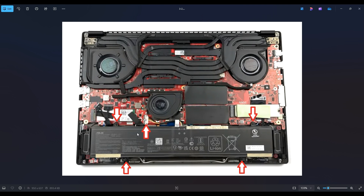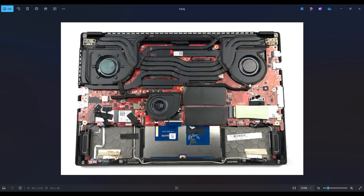I will have a video link below in the description — a tutorial showing you how to troubleshoot a laptop that's not turning on. You have two M.2 PCIe X4 slots here. The one on the right is where many of you will have a solid state drive in stock, and the one on the left near your Wi-Fi card will often be empty stock. These slots take Gen 4 solid state drives, and the stock drive will generally be around 500 gigabytes. Below in the description I will have several different options for solid state drives: a smaller 2230, a 2280 one terabyte, and a two terabyte drive.